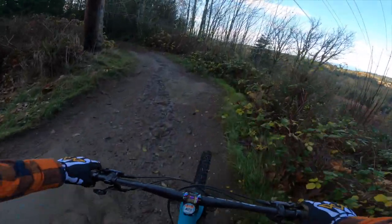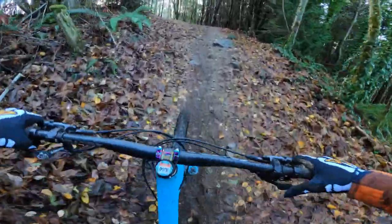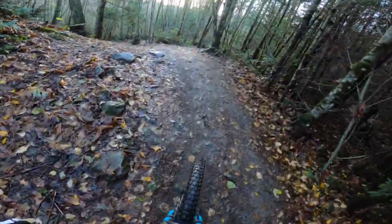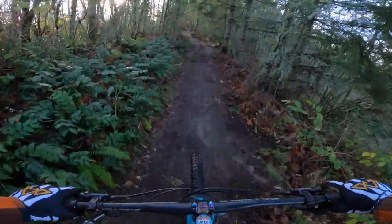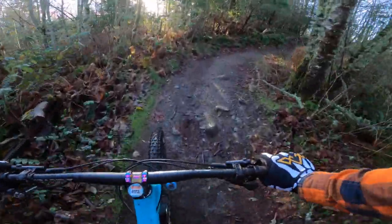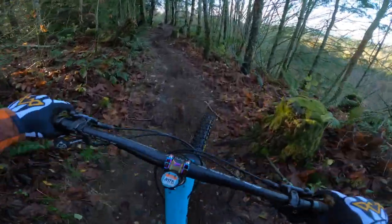This spot is a great test for what I call the wrong gear. I'm in a way too high of a gear right now, pedaling pretty hard, and about to downshift under pressure. It's never a good idea to shift down under pressure like this, but the Advent X handles it pretty well. Coming out of the granny gear, a couple drops into higher gears. This drivetrain has probably been used 400 to 500 miles and it's still perfect. I've only had to make a couple of micro adjustments, but overall the up and down shifting over time has been excellent. I really think 10 speeds helps — makes it so you don't have to fine-tune it as much over time.